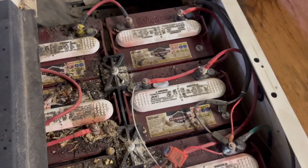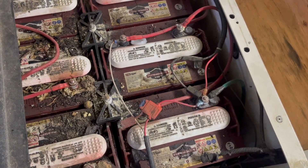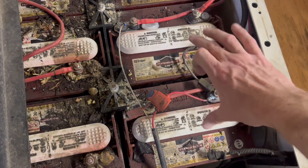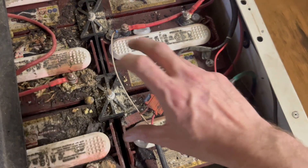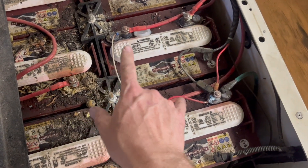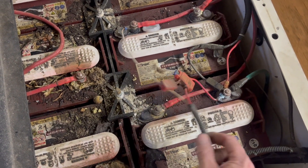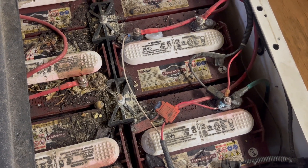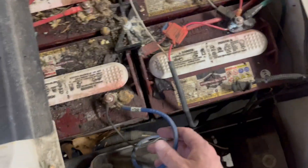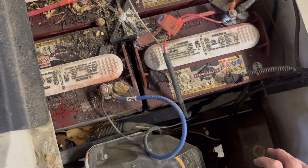There are a lot of things attached here — each battery is connected to the next one, making the whole pack act as one big 48-volt battery. But then you have connections like this: positive here and ground there, which means it's only taking two batteries in series. If this pack were charged and operating, measuring across those two would give us 16 volts. So this is where we'll need to attach our 48-volt to 12-volt converter — everything else, all the other non-motor wires going to the golf cart motor and controller.